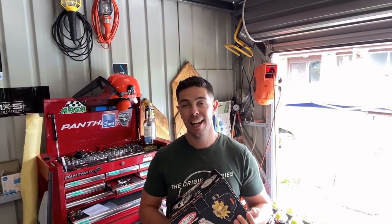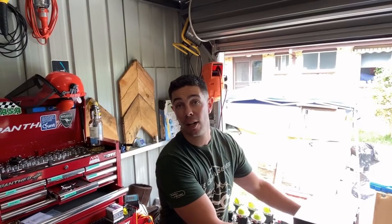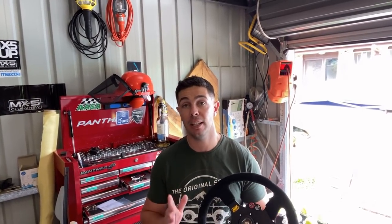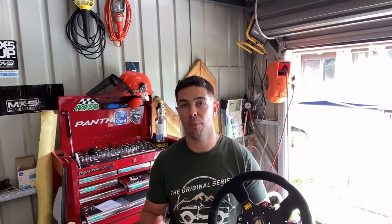The things like to throw bearings, and also the stator will hit the housing and cause you a bit of trouble. So I'll run over all of that and give you a bit of a template so you can size your electrical load, so you can purchase the right alternator, and just having a quick look at alternator curves and that sort of stuff, so you can make the right selection there. Hopefully that'll be helpful. I'll also run over the wiring of those things, because that can be a bit tricky if you're doing any sort of custom build where you're doing an engine swap or something like that.